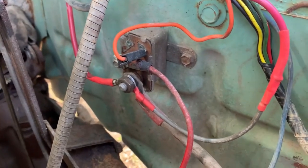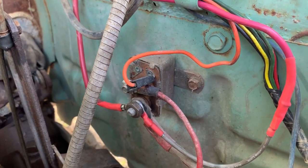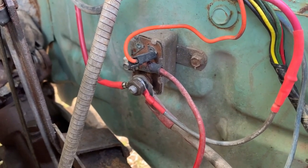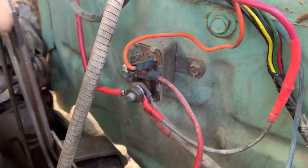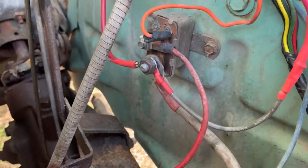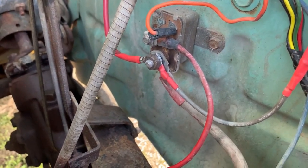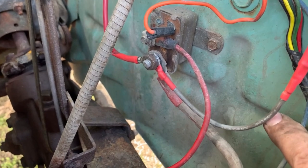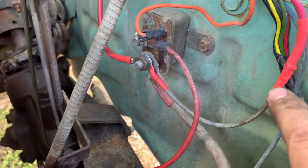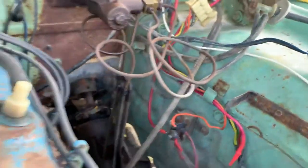Here's a fairly clean view of what's going on down here next to the starter relay. Mopar has used this starter relay on several other things, so it should be fairly self-explanatory. That big fat lead coming in on the left jumps onto the starter relay; this red one comes off of the alternator; the big fat lead going down there goes to the starter. This guy here is a 14-gauge fusible link, and that is going to be run inside to the original harness.